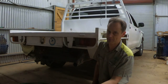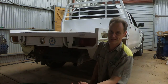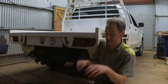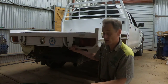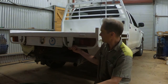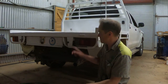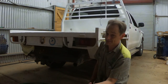That doesn't really happen anymore now that people have moved to dual cabs and 4x4s. But when people first had things like the early Toyota Stouts, early Toyota Hiluxes, Holden Rodeos, a lot of people referred to them as tonners. But a lot of them, in fact you could say most of them nowadays, vehicles have got heavier and their GVMs haven't altered a whole lot. Their payloads have decreased and they're not tonners. This one can't carry a ton. This is circa 800 kilos. So if you add excessive weight with a trundle tray, you're going to eat into your payload. And that kind of sucks.